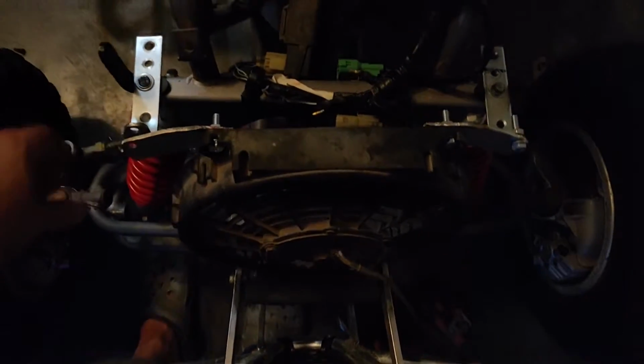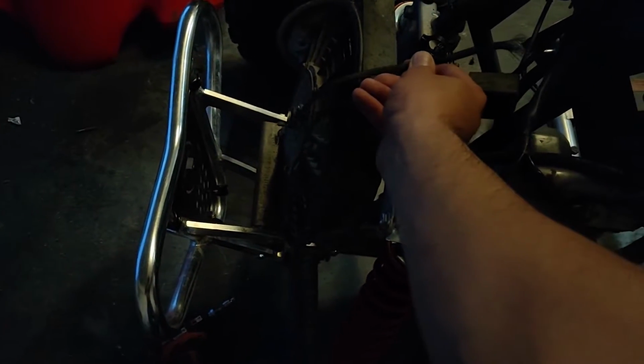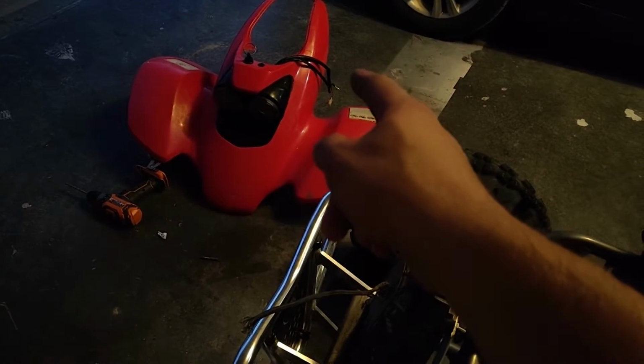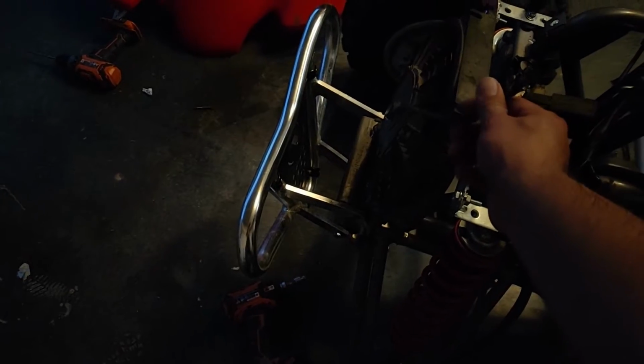So now it's time to try and wire this thing. We'll see how that goes. I'm going to run a power wire from the positive side of the terminal, following the wiring harness all the way up to here. Probably run it right through here, and then I'll split it off and have an attachment where this will plug in, and then the other side, actually, it has to go into the positive side of that. I forgot about that. And then it has to come out of that because I'm going to put a switch over there. And then from there, the negative side of this can go straight to ground, which I'll probably ground right to one of these bolts here on the starter solenoid, or whatever this is, the ignition coils. I'll probably just connect them to that.